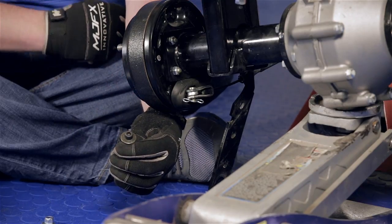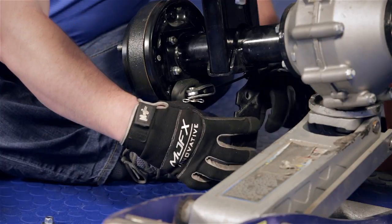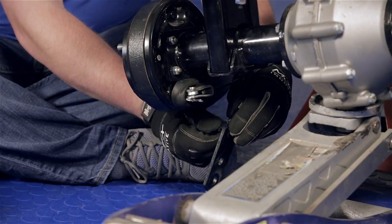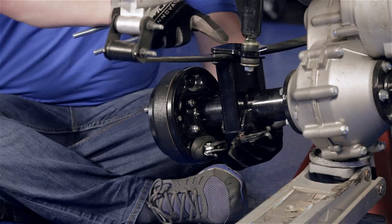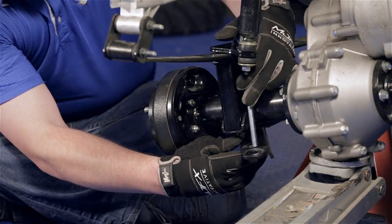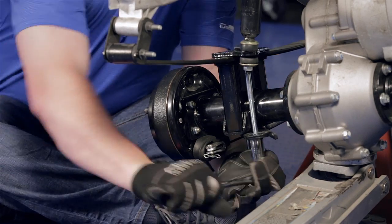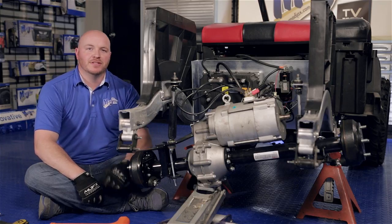Using the hex head hardware supplied in your kit, we're going to attach it to the factory rear shock plate in the middle hole, with the head of the bolt inserting into the bottom hole of the rear axle, and tighten it with the nut. Now we're going to install our U bolt down through the new shock plate and down through the old factory shock plate, and tighten using the 17 millimeter socket — make sure both sides are tightened equally. Now that we have our U bolts attached we need to tighten our shock nut.